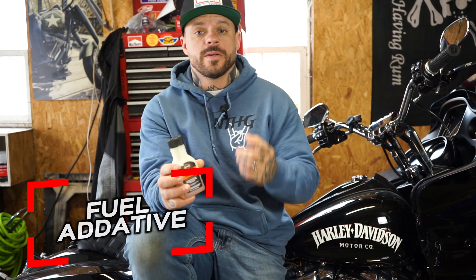The first thing I want to talk about is fuel stabilizer. This is the Harley brand — there are obviously other brands out there. What I always recommend is fill your gas tank pretty much all the way full, check the bottle for how much to pour in, pour it in, let the bike run for about five minutes to let it circulate. Then next spring when you come back and hit that switch, the fuel is going to want to fire and you'll be good to go.